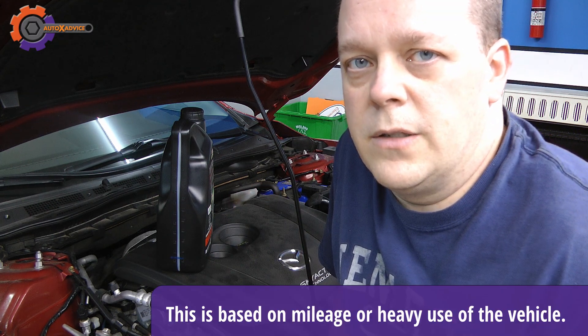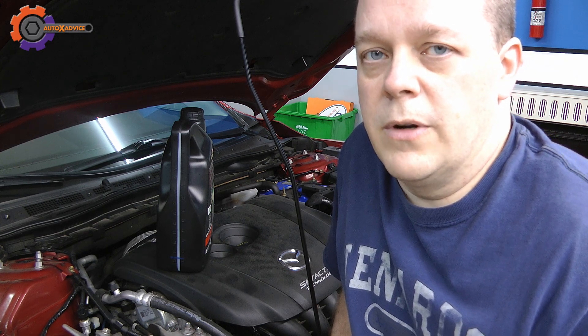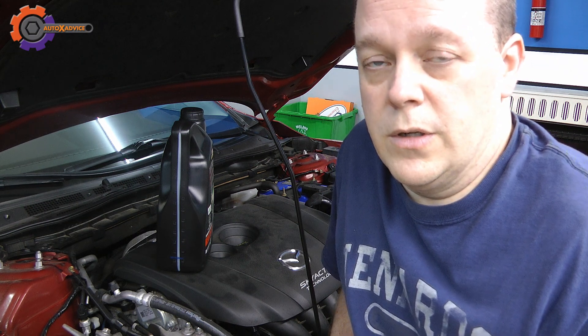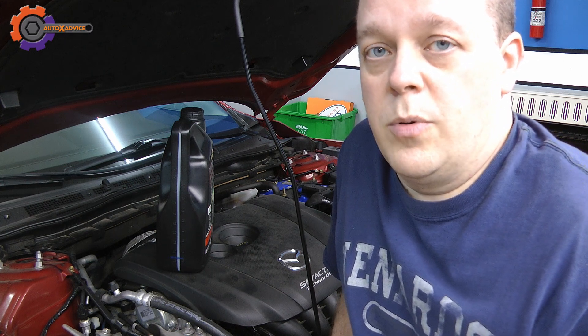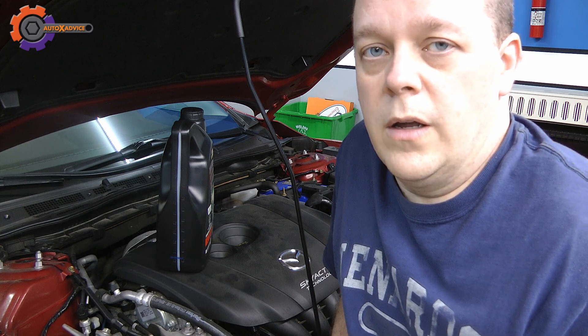In your owner's manual you'll find a certain time period to change your oil. What I've done on all my cars for the last 25 years is change the oil every 5,000 miles. I know some oils can last longer than 5,000 miles, and some manufacturers might say between 3,000 and 5,000. It can get a little complicated to keep track of exactly when, and 5,000 is a really good mark. If you want to follow the manual or the manufacturer of the oil or filter, that's great too. It's not so much the timing as it is making sure you do change your oil at specified intervals and not wait too long — that oil starts to break down and will start to gum up, and you don't want that to happen.